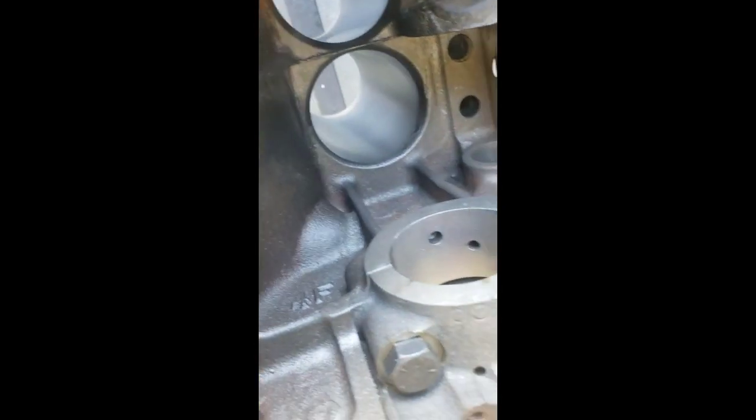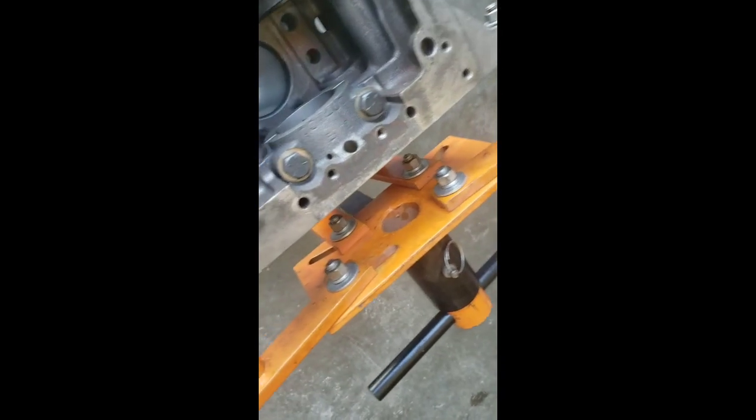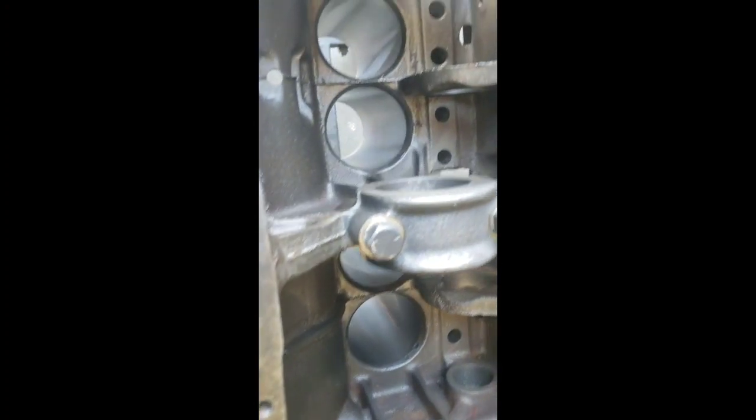You have your oil, that's the little bearing pin hole. But then you have your oil hole for your main bearing. Okay, so you want to get that. Then same for the front and the rear. And then you'd normally have that little pipe that hangs down. I don't know where that went. That's interesting. I can't remember if it had it there when we took it apart or not. Interesting. Okay, so you want to clean all those passages up.